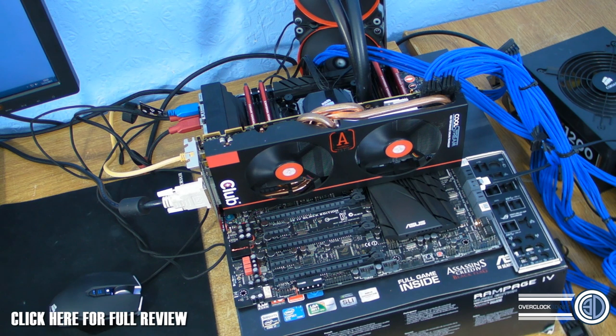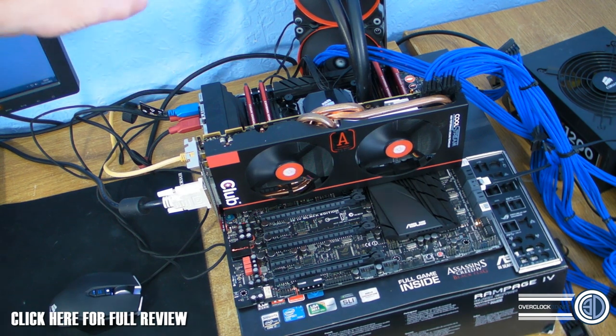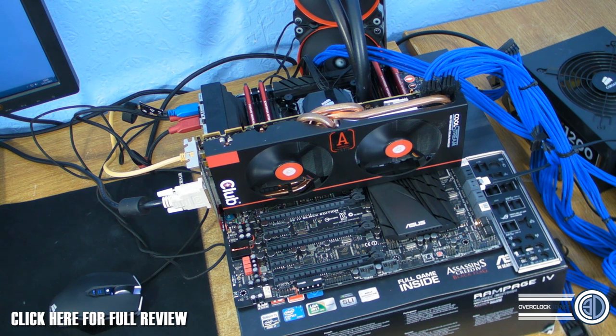So essentially, the rig today slightly differs from what we would have done with 2011 rigs before, whereas we've got the 4960X in this now. Obviously, it's a new chip, and I'm not going to say that the Rampage Black was designed for it, but it's a newer board, and they probably would have been using the newer chips in mind. We do know that they've opened up bandwidth for the memory so that you can get 2800 megahertz and 3000 megahertz if your CPU is able to do it. So we thought we'd use the new CPU to be able to test this factor out.